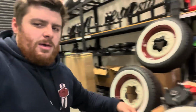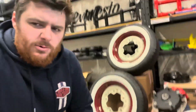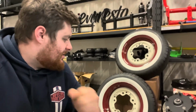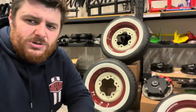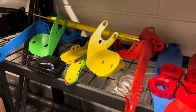And then in the rear, we've gone for a 195/65, which is a little bit bigger than what we'd usually fit. This car isn't going, you know, we're not doing stupid, like we're not flat panning it, we're not engine raising it for now. So a big fat tyre, filling the arch a little bit better, also giving a slightly better cruise speed on the motorway is going to be good for us. So we've got a proper classic, big and little tyre choice on here, which I think is going to look absolutely brilliant. Here's one of our usual premium rear kits, of course done in the Toy Town colour scheme.